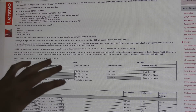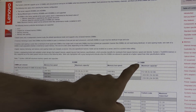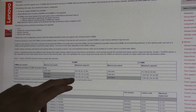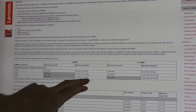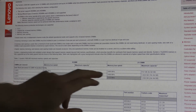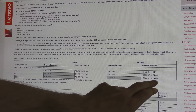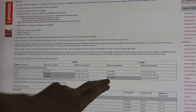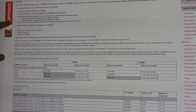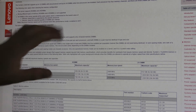Here in the Lenovo press release about the x3650 Model 5 you can see exactly what I mean. There's a section about RDIMMs and LRDIMMs. With RDIMMs you can get a maximum of about 768 gigabytes using 32 gigabyte blocks, but you drop down to 1866 megahertz. With LRDIMMs you can go up to 1.5 terabytes using 64 gigabyte blocks and only drop to 2133 megahertz. And it clearly states: mixing RDIMM and LRDIMM is not supported. That was my mistake.